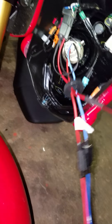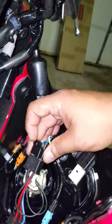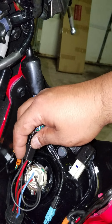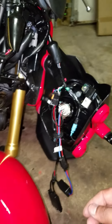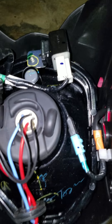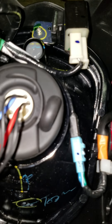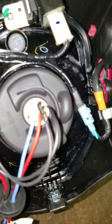Connect your ballasts — simple process: red to red, blue to blue. This original piece is the one connected to your original light — pop that off. I forgot to put the rubber cap back on, which is very important, so I'm going to have to run all these wires again to get that in. Once you get everything in, put the rubber gasket and rubber cover over it, plug everything in, and I highly recommend covering the connections with electrical tape.